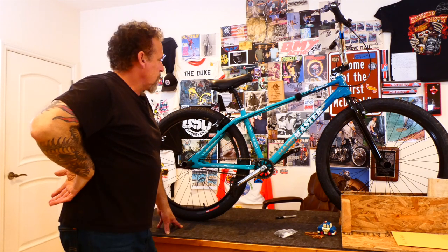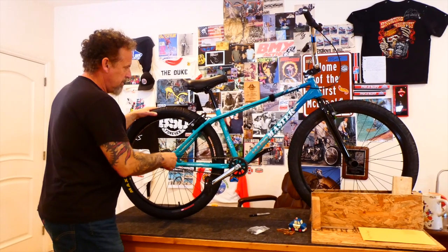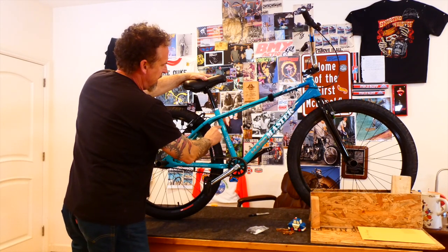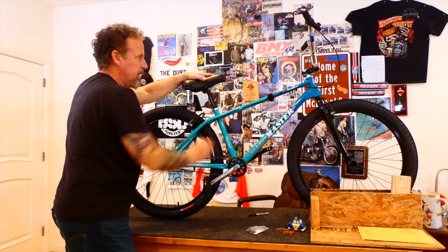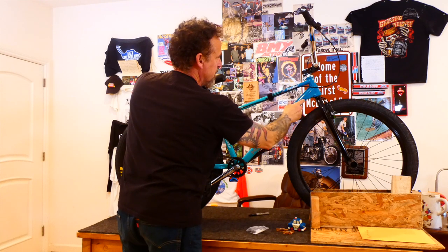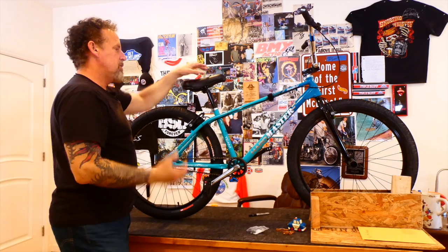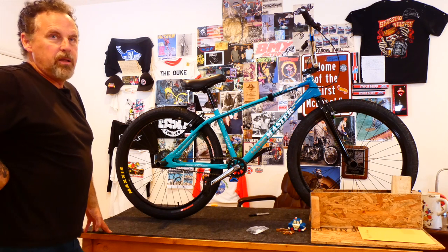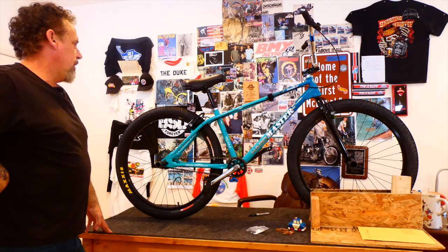On this bike, these are measurements to change the rear end, which probably won't happen on this customization, but we are gonna drop this down 1.5, 2 inches. This will make bar tricks on your top tube easier. And I'm gonna go to a steeper head angle, which we're gonna cut a pie into here. This is William Johnson's idea. Slice these and bend it back just a little bit, get it a little steeper. Those are the frame modifications. We're supposed to start those tomorrow. He said he'd be back Tuesday. Cool, I'm really looking forward to that.